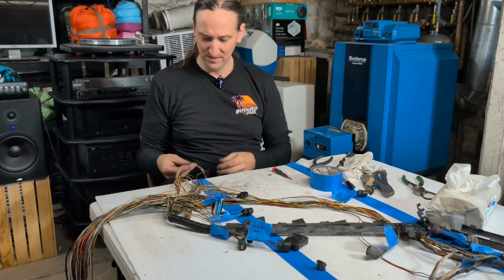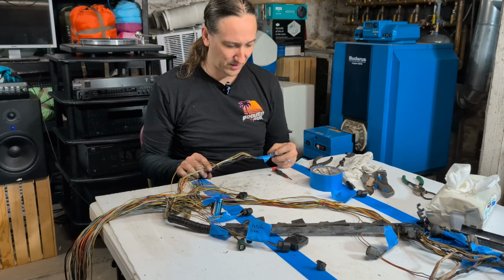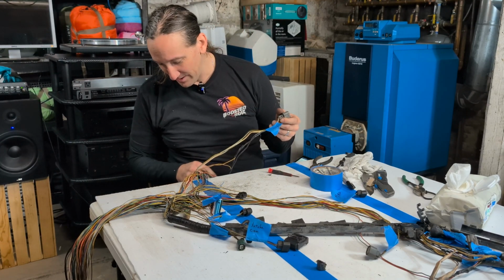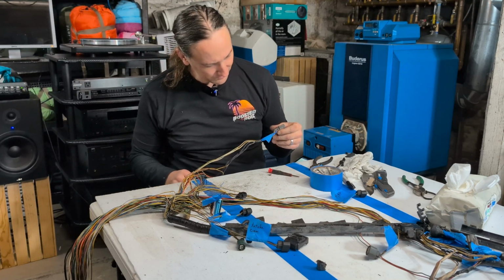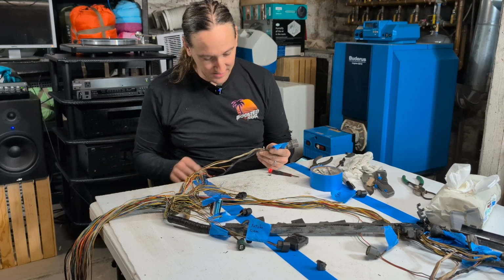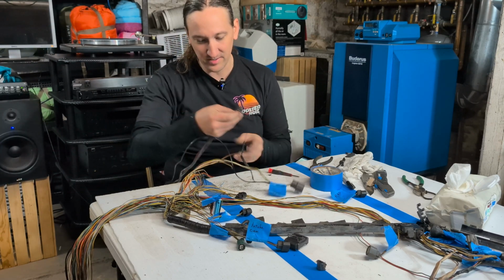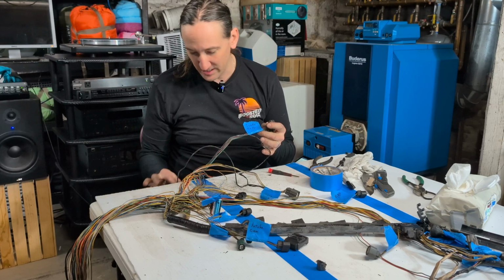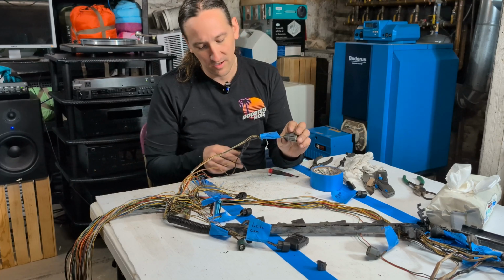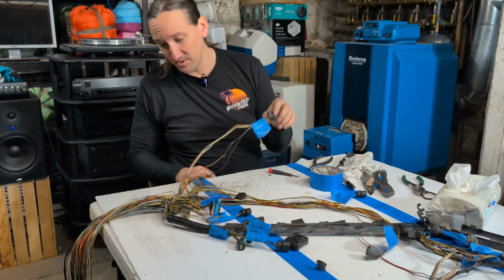And I wonder if the 4th wire is some type of sensor, where you have commanded versus result, maybe an actual sensor in there. I don't know. I'm not too worried about it. What I do find interesting is that coming back off of the alternator wiring, it ties into some shielding wiring that's going to the throttle body sensor. So there's this wire here that has an outer jacket. It's a shielded cable. And then the shielding's coming off and going over here to the alternator to protect one of the wires for the alternator from noise, which is interesting, but sure, okay.